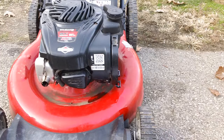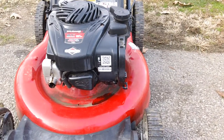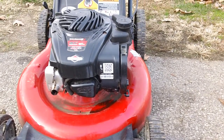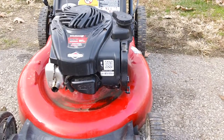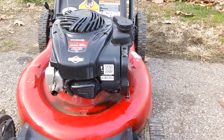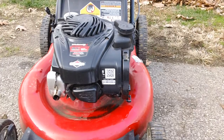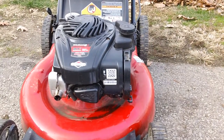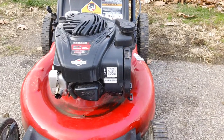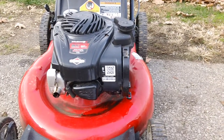Because of that, we took a look at it, and he had tons of debris and water. There was actually water down the bottom of his fuel tank and on the top as well. And these things don't have a filtration system like a car or a truck. All they have is basically a mesh screen in the bottom of the gas tank, and it's only meant to stop large particles. It's not designed to stop water. It's not designed to stop small, dusty pieces of stuff that might get in your gas tank.